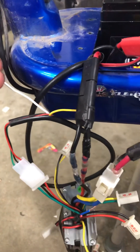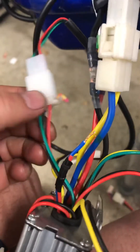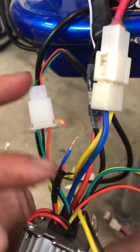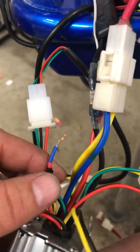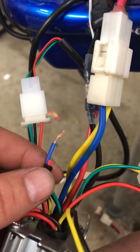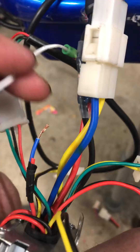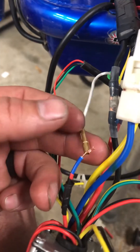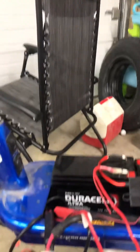This is the lock. Here's the lock right here — it's blue and red. It came with one of these blue and red connectors. If you don't have a key lock, you cut these two and wire them together because it's basically making a loop. Since I do have a key, I tried tying all three together and nothing worked. What worked was eliminating the red one and tying the white to the blue — then my key works and I can turn the machine on and off.